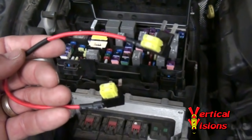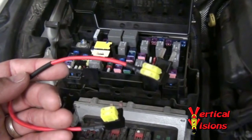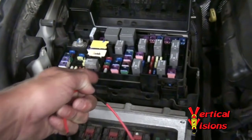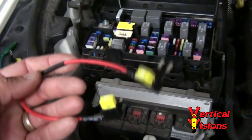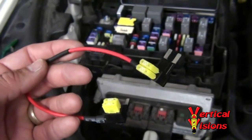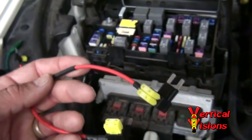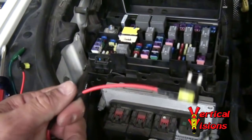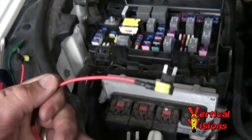That's better done with LED feedback, so you can see if the LED is flickering on and off and know the fuel pump relay is toast. You can also stick a multimeter down to M25 whenever someone's starting the vehicle, and if you don't see any voltage — no 12 volts across those leads — you'll know. Or if your vehicle's not starting, in all likelihood you have a bad fuel pump relay, and hopefully you've tested your fuel pump to determine that other components within the fuel system are working properly.